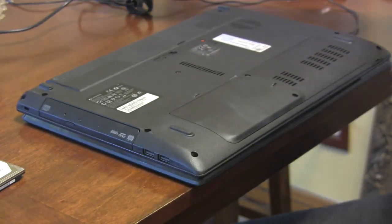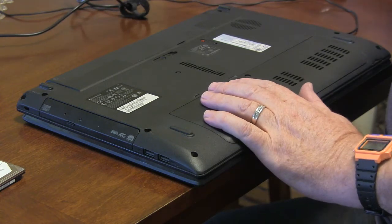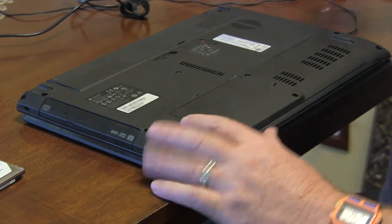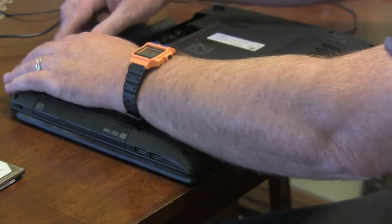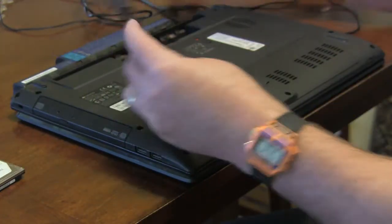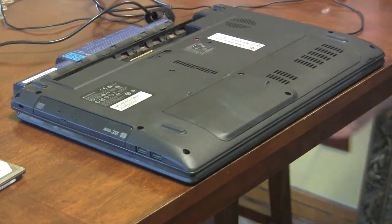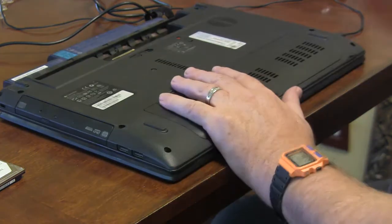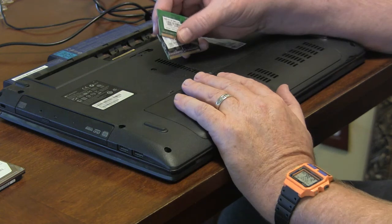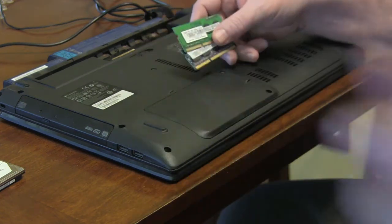The moral of the story is: it was dead, but they gave me the wrong charger. The charger they gave me was the right voltage but had the wrong current. So I took the battery out and found a different charger — the one they gave me was a Toshiba, still the right voltage but with the wrong current.